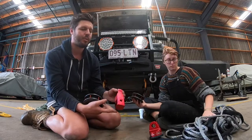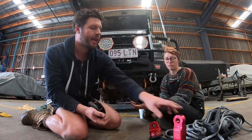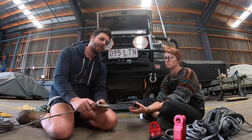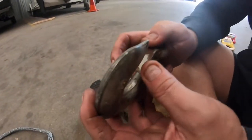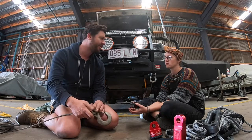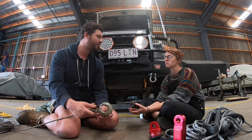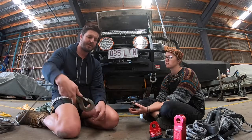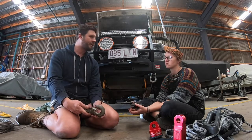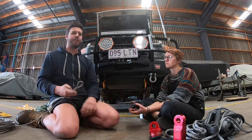This is not a Factor 55 Hitchlink — we will get one — but theirs actually has a machined radius in here as well, so you can run a soft shackle in it. Another area where they've really reinvented the wheel is the hook. That is the hook that traditionally runs on steel cable and also Dyneema rope. It's interesting because this hook is really just adapted from the rigging industry — it's not an ideal instrument for four-wheel drive recovery. It's a lifting hook, not a pulling hook. It has a weak point and it's not a closed system.